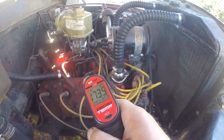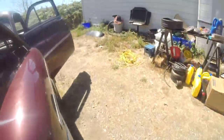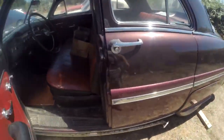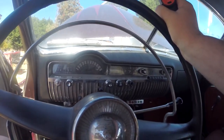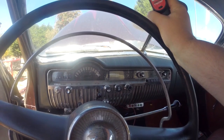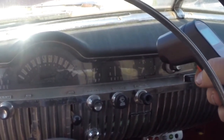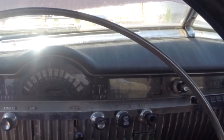This side looks like it may be getting up to the temperature to open. There's a similar temp on each side, which is a good sign — it's within four or five degrees. I have heard that some flatheads will sometimes run quite a bit hotter on one side than the other, like 20 to 25 degrees, and I'd rather not see that — it would probably mean the water pump on that side is weak. The gauge is right at the three-quarter mark, which is kind of where 160 degrees hits for the thermostat to open.